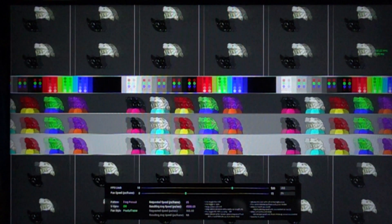Try moving a window around and it just looked horrible. For context, here is what the medium overdrive mode looks like at high speed — it isn't quite OLED fast, but it finishes drawing the frame with a millisecond or so to spare, meaning very little motion blur and next to no ghosting, plus little to no overshoot. It's a great experience, 10 out of 10. Now here it is on strong — it's a disaster. Pay special attention to the white frog in the middle: look how burned-in it looks, especially when it's moving. Even the black frog is visibly off. Please do not use the strong OD mode. It is awful. Use medium instead.